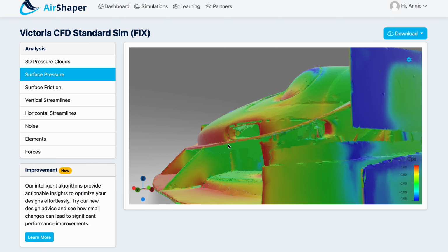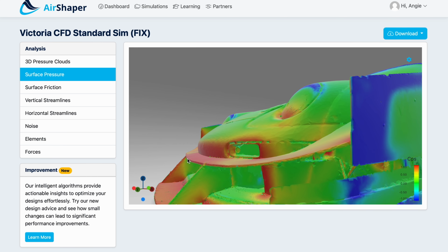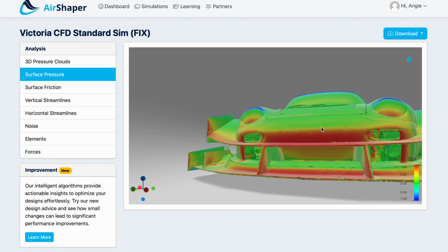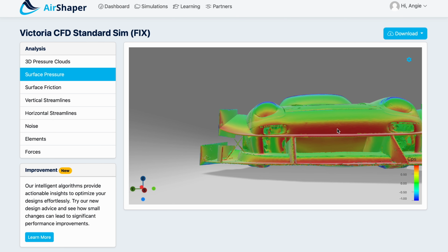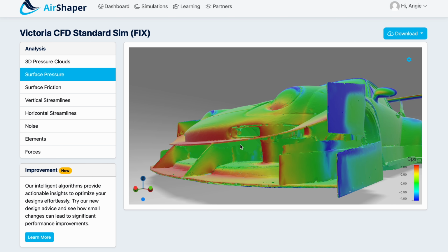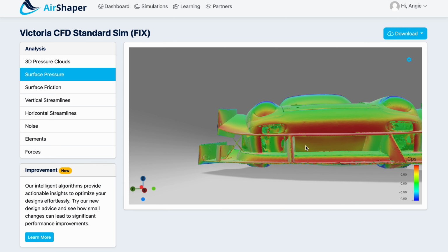So technically, if we wanted to improve the design of the aero here, we wanted to create a sort of wedge shape here, which allows us to remove this flat spot. The flat spot is a high drag area, and what happens is that it is a wall. It's almost like sticking your hand out into the wind and not using a blade, rather than just stopping the wind. So that's what that looks like, and you can see the high pressure areas generated here.